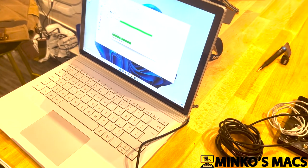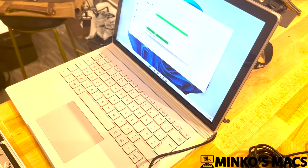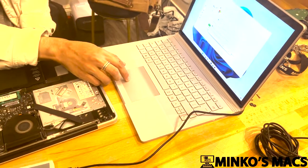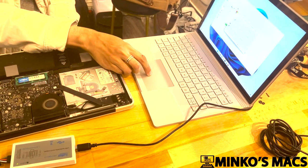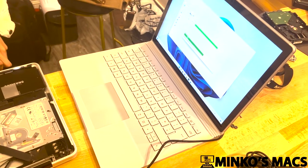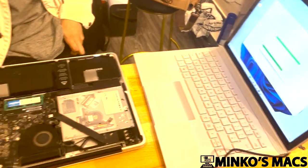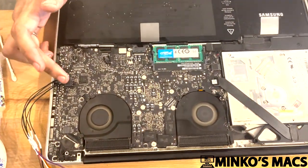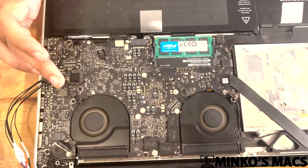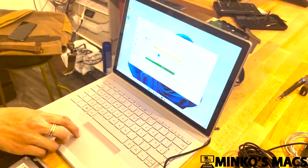It will download the firmware and then it will prepare it and start flashing the G-Mux firmware. As you can see, the G-Mux firmware is now flashing. You always want to check your connections, especially if you're using this MagSafe 2 — it doesn't perfectly align. As you can see, I've had to put some wires in as little spacers or jumpers for the actual connection. And as you can see, the G-Mux has been done properly.